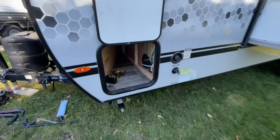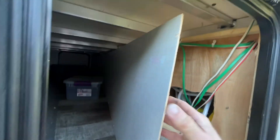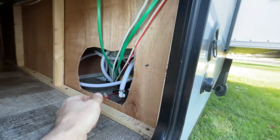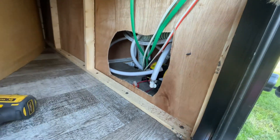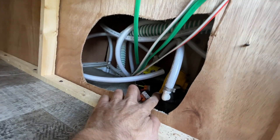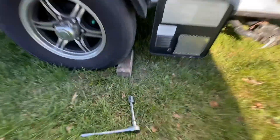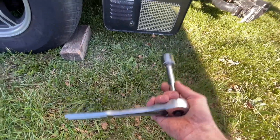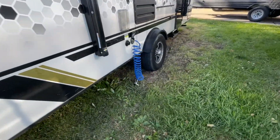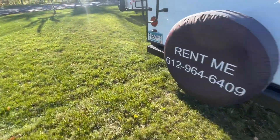I've prepped slightly here. If you go in the storage compartment on this side, you need to take out about five screws — there's actually a note on it about winterizing access. I've pulled that forward and we've got our hose to suck in the RV antifreeze, and we're also going to check the filter on the inlet side of the pump. I've got my water heater opened up, with an inch-and-sixteenth socket on a ratchet with an extension. The tanks have been drained, so in all other respects this is ready to go.